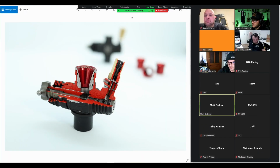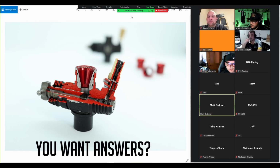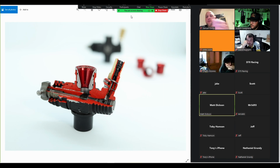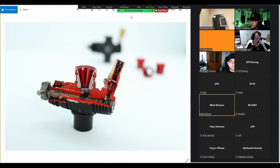I have a question just on the subject of airflow into the carb. Do you find yourself changing the size of the Venturi you're using from track to track, or do you typically use the same Venturi everywhere? And what kind of size range do you keep in your toolbox? Is it like a 6.0, a 6.5, and a 7, or do you use other sizes than that? Would you say there's something of a recommended base setting? I know altitude kind of changes everywhere, but is 6.5 or 7 kind of a good place to start?